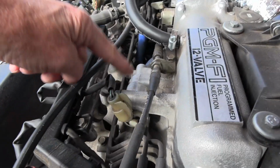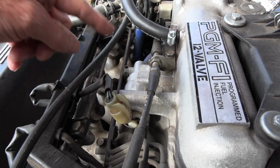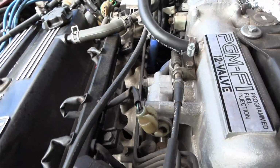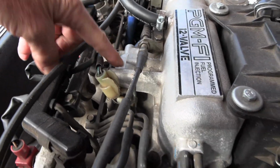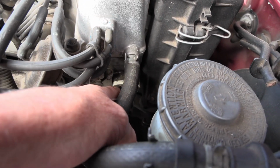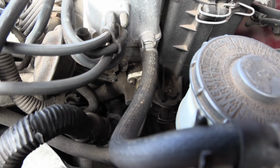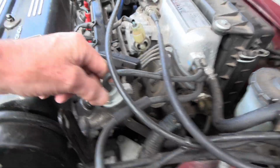And right here, this is your idle air control valve, electronic idle air control valve. So notice it has a wire coming through it, okay? So that is your idle air, oh, my microphone's coming loose. Okay, so this is your idle control valve, electronic idle air control valve. There's your wax pellet one. Right down here, this piece with the white, that is your intake temperature sensor there. See, it goes into the intake manifold and it's got that little white piece. Or they're white anyway. Okay, it's not a sensor, but this is your fuel pressure regulator.